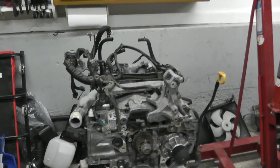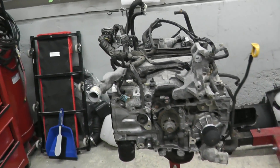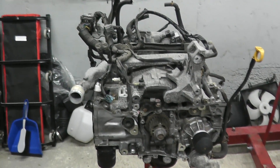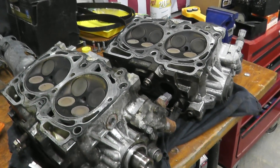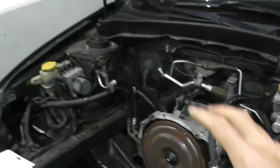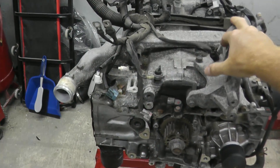With the cylinder heads and intake removed, you can really see how compact this engine is — the engineering is very well thought out and it's quite easy to work on. Just take your time, go slow, step by step. The next step for me is bringing these cylinder heads to a machine shop to check for straightness and cracks, inspect the valves, and clean everything up. Then we'll reinstall them, put the engine back in the vehicle, and get it running. Thanks for watching.